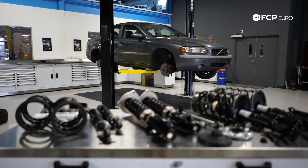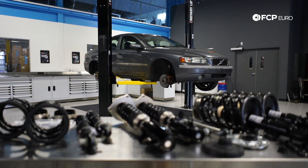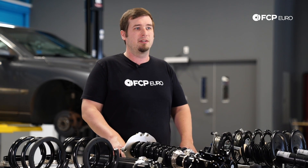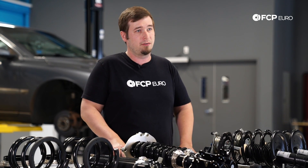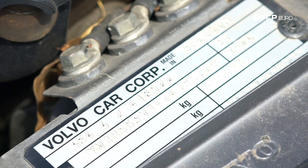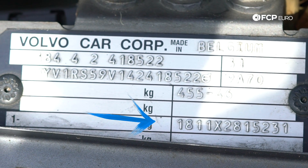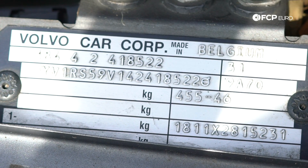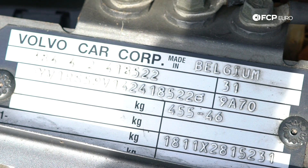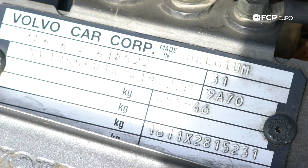Depending on the equipment installed, P2 chassis cars have multiple spring and shock codes, which are important to pay attention to when shopping. Up to and including model year 2003, these suspension codes cannot be decoded in the VIN. Instead, you have to reference the VIN plate for an alphanumeric series of numbers that denote the correct parts for your vehicle. This is basically the build sheet for your car. The VIN plate is located in either the engine bay or the passenger door jamb. The digits in the suspension codes starting from the left represent the front spring, front strut, front sway bar, rear spring, rear shock, rear sway bar, front bump stop, and rear bump stop. Early models may have a combined code for the front and rear spring and shock combinations together, so those will feature 8-digit code plates instead of 12.